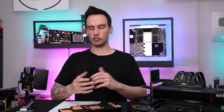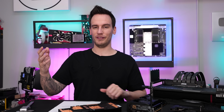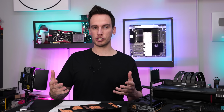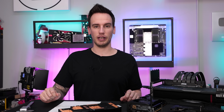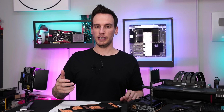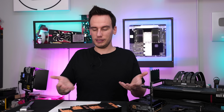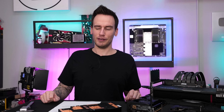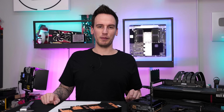So then again, I also checked with Igor, who then got in contact with a vapor chamber vendor. And from their expectation or from their knowledge, looking at this, they assume that there is simply not enough fluid inside the vapor chamber, which is also what we estimated in the previous video when we did the flip test. So in the end it seems to be a few milliliters of water missing, a few very expensive milliliters of water for AMD. That's probably it for today.